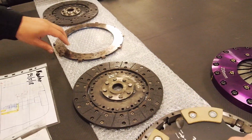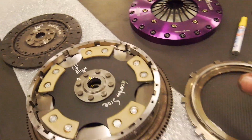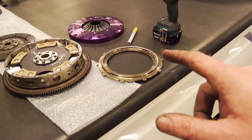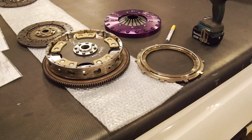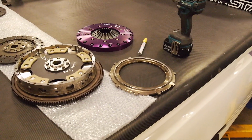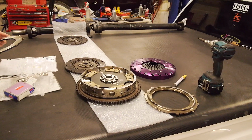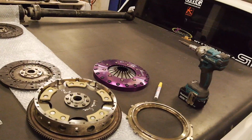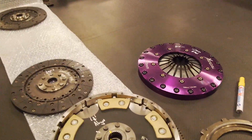These are much more tolerant to heat, hence why I did it, because this car carries a lot of load all the time. And reverse gear is still very tall on this, so I normally smell the clutch in reverse. Since we did the diff ratio, it's been good, taking off in first. But I just needed more longevity.